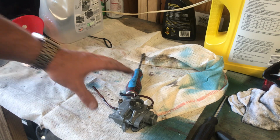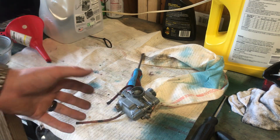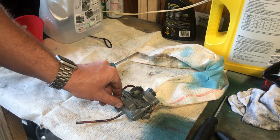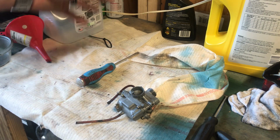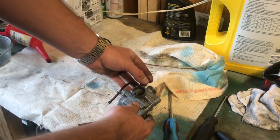So this is a good time to take your carburetor off and clean it, which I do have a video you can check out on my channel on how to do that for this exact bike. But what I'm going to do is take everything apart and just coat everything with two-stroke. And so I started by draining the bowl here.